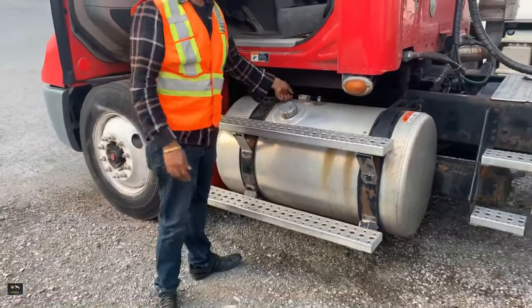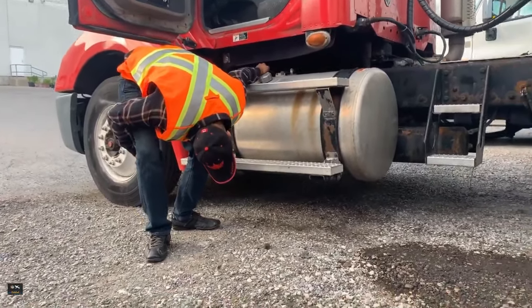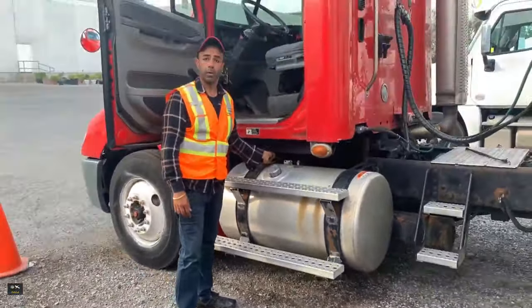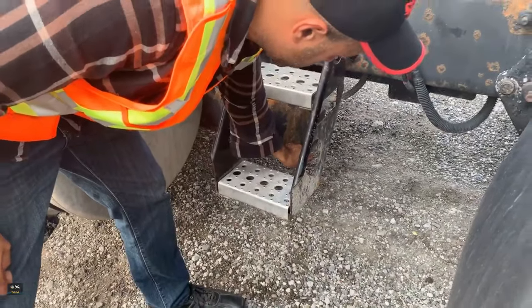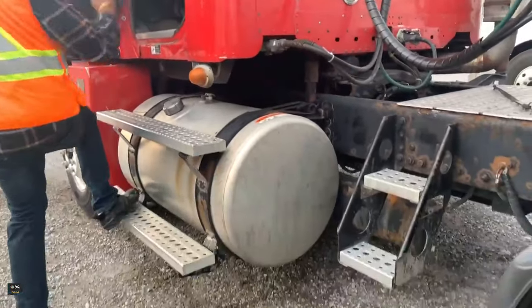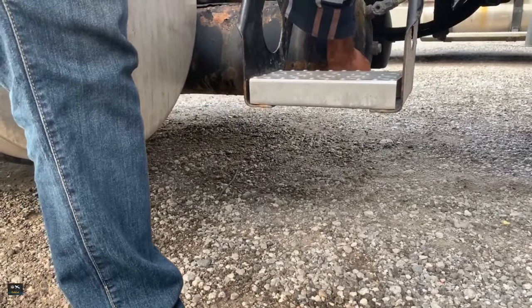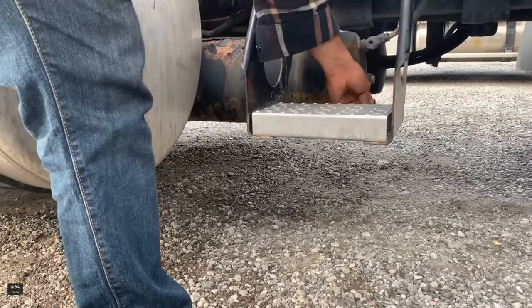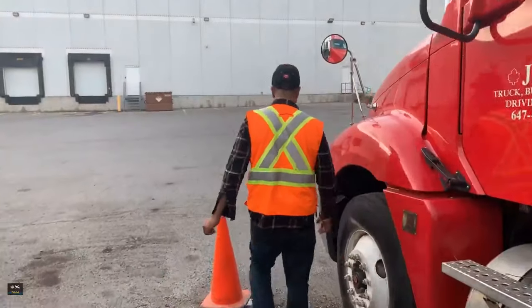Since I found my wet tank, I drain it and look underneath the tank to see what kind of moisture is coming out. I pull the drain valve — I don't see any oil or moisture coming out and the drain valve is working properly. I move to the next tank to identify it. It turned out to be the secondary air tank. I pull that drain valve and look for any abnormal discharge — no discharge, no oil, no moisture, and the drain valve is working fine.